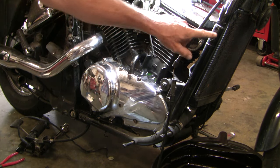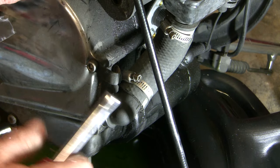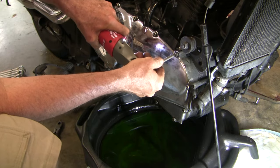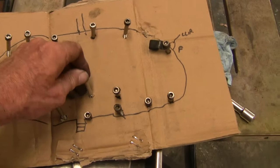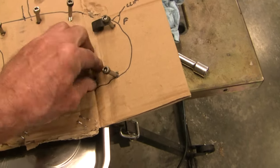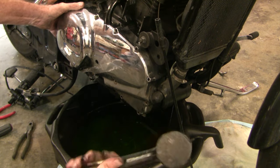These are 8mm Allen — two of them here and two of them there — and these are 12mm Crescent. To the front of this clutch cover is this connection here; rather than undo it there I decided to just undo the hose. These clutch cover bolts are 5mm. Be very careful at this stage — take them out in order and label them. This bolt here is really long, most are medium sized, and these three are short. Don't get them mixed up. All the bolts are undone and as expected it's stuck on there; there are some little lips that look amenable to tapping with a dead blow hammer.